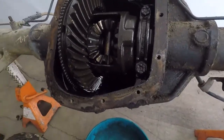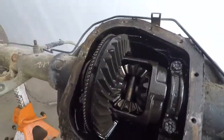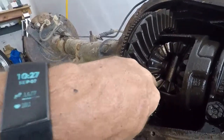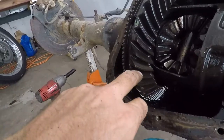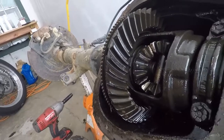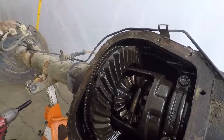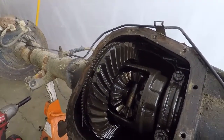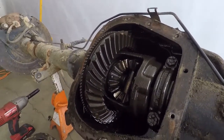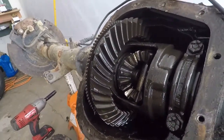I don't see any side-to-side shims — they're probably in there somewhere. It looks like it may all be done with just the pinion. You can see a little fretting. Yeah, that stuff is terrible — wow, that's gross. The best bet will be to use my center section since I just rebuilt it. I know the gears are decent; they aren't worn out. I'm going to use those gears anyway, but I don't know the condition of this one, and looking at this fluid — she is something else.